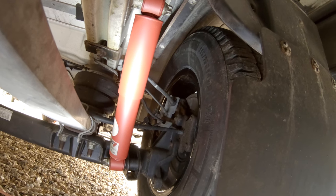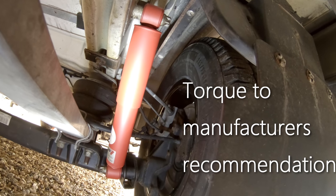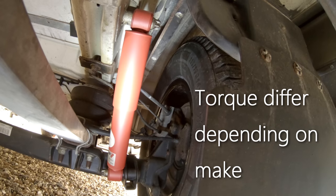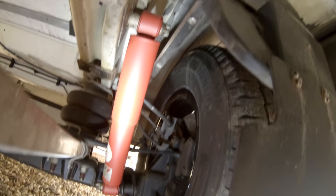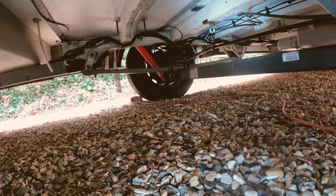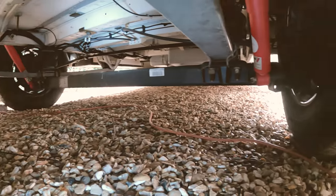There's the shiny new — well, no longer shiny — new shock absorber installed. I just need to torque down those two bolts, top and bottom. I'll get Dave to tell me the torque information. He's obviously waxed it to protect it, which is why it's no longer shiny. Sexy new shock absorbers — hopefully now she'll pass her MOT. One other thing: Dave says you should do both sides if you're changing one. Change one, change the other.